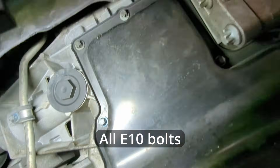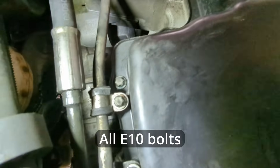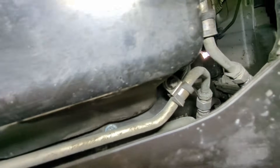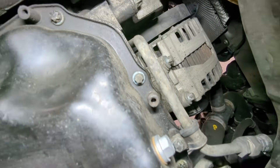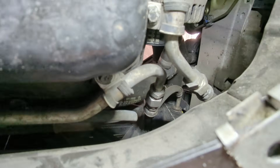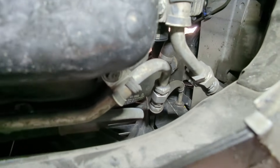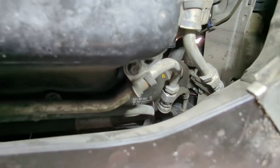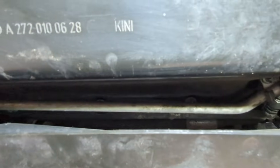Here's the engine oil pan. All of these bolts got to come off. Showing you all the locations. This transmission cooler line, this hard line right here, is blocking three of the oil pan bolts. Those three behind there, which means you're going to have to lower it. That's the rest of the bolts. That hard line is connected to a soft line going to the radiator, so hopefully a combination of undoing the bolts holding it to the pan as well as lifting the engine up should give me clearance to get a wrench on those bolts.